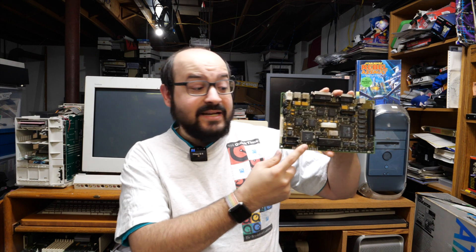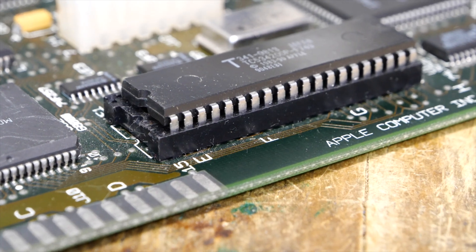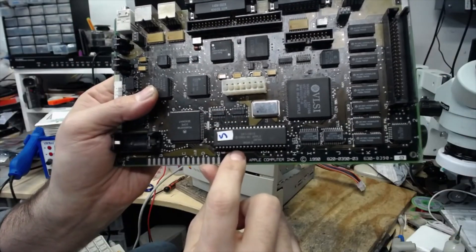It's quite simple to screw up the ROM orientation on these Macintosh Classic computers. The ROM socket has two extra pins to the right of it, facing the battery holder, so when you take the ROM out and put it back in you can accidentally shift it over by one space and connect the pins incorrectly. When Logan did this the ROM got very hot, confirming he'd broken it. When I tested the machine after recapping it using my own ROM, it worked perfectly fine — that confirmed his ROM was the problem.